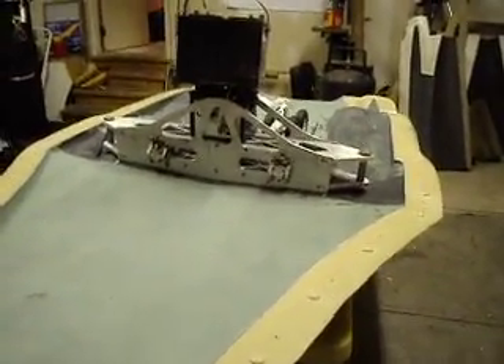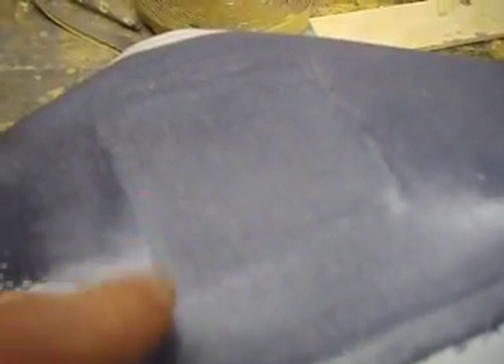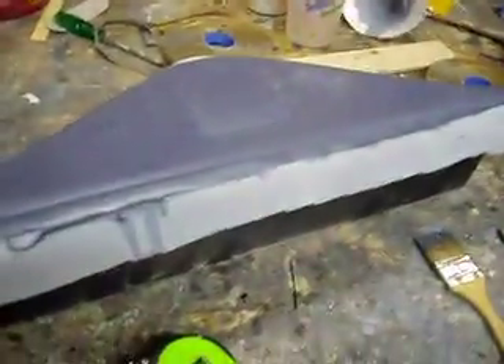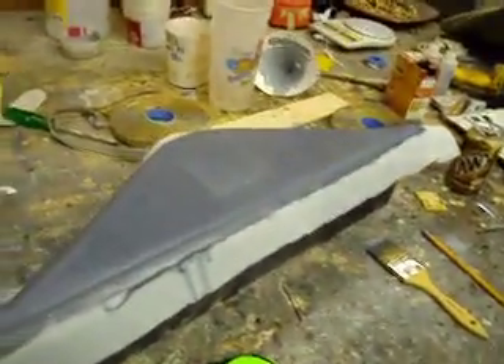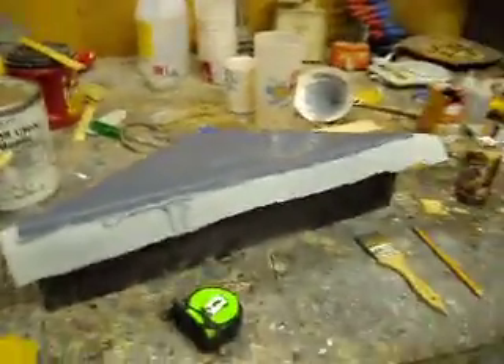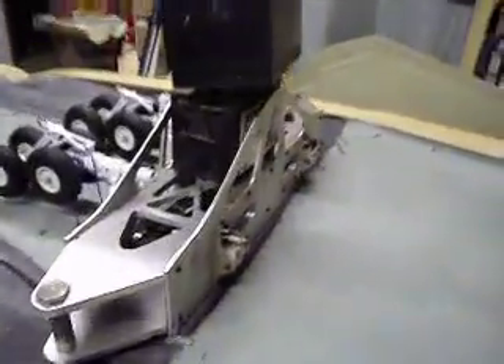I got my gas tank — I got the last layer of carbon on it. This is where I'm going to drill my hole for my clunk, so I put an extra couple layers of carbon there to build that up so I can get some thickness when I drill the hole — my stopper will work nice in there. I'm going to get that trimmed tonight and get my hole cut in it, pour some lacquer thinner in there to see if I have to cut it apart. I'm probably going to have to, but then I'll get that tape done tonight so I can get it installed in the morning, because I can't start until that gas tank's done — it's got to go right there.